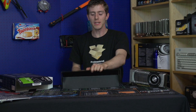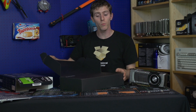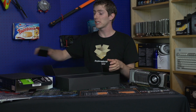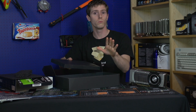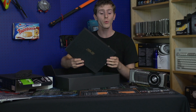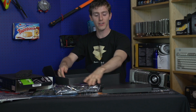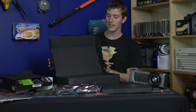I'm going to spoil the surprise a little bit. It's a GeForce GTX 770, which means it's based on the same GK104 core as the GTX 680 — a fully enabled core to be more clear. So it's essentially a GTX 680, but clocked higher. This one in particular is an OC-level card and it also has 7 GHz GDDR5 memory, as opposed to the 6 GHz GDDR5 memory found on the original GTX 680.